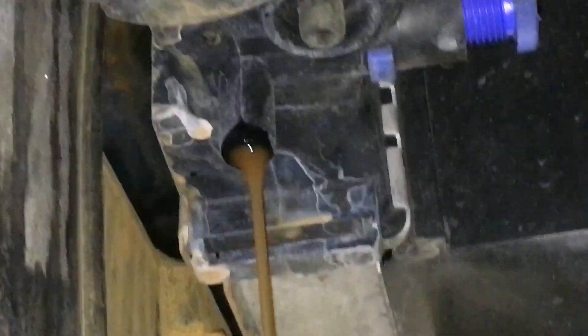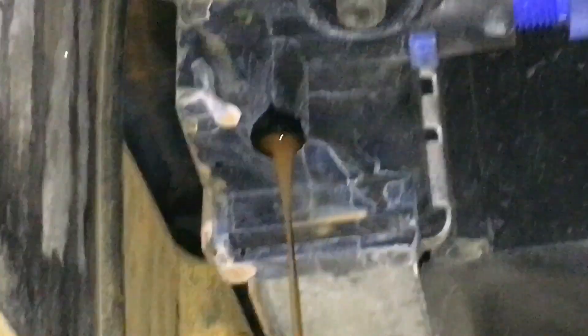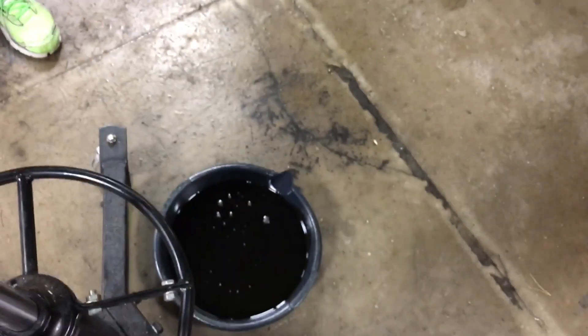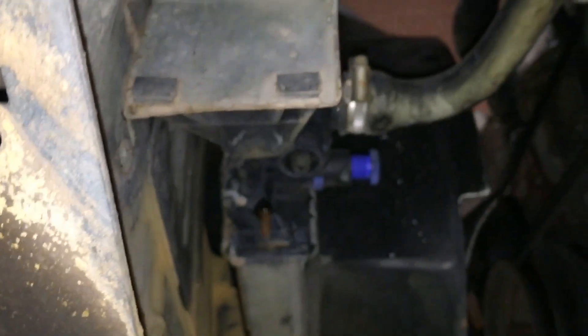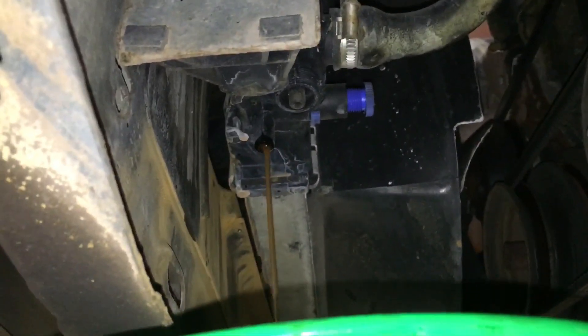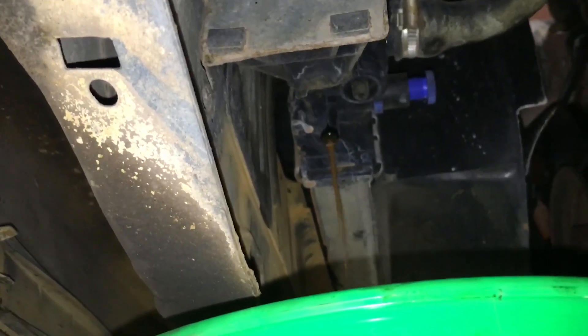So that's what's in the radiator on this car — some light macchiato. Oil pan's all drained. Power steering lines are disconnected and still draining because those always keep draining. I'm gonna start loosening some hose clamps on the cooling system now to relieve some air pressure so it doesn't keep doing this.